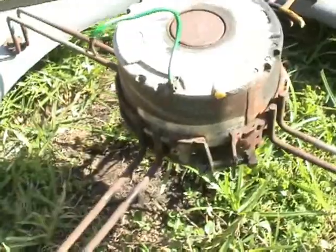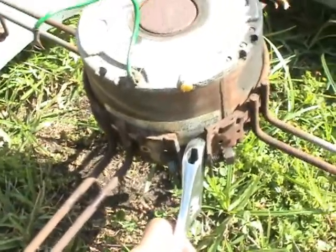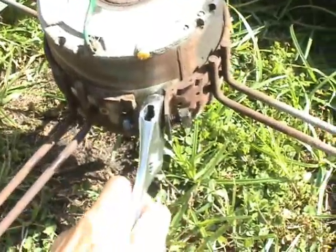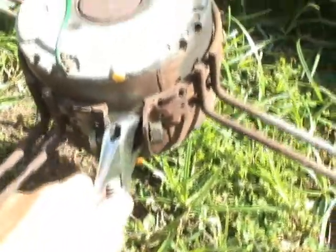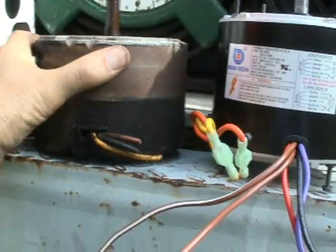Now it's time to remove the motor from this band - it's called a belly band type of mount. It's a good idea to take a wrench or something and just pry this mount apart a little bit so that the motor can slide off easier. Push it off and there it is - right here is the old motor. You can see three wires came out of this one.